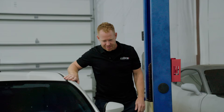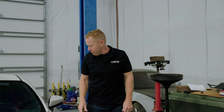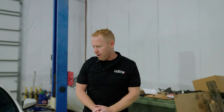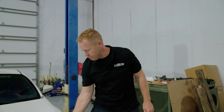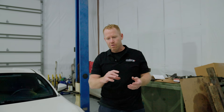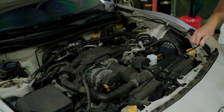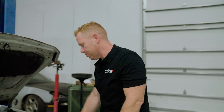This is actually a really good chassis, however we do have a common problem with the engines. The FA20 flat-4 just rod knocking for no apparent reason — this happens very commonly in the Subaru space. This specific chassis was 300 miles short of 200,000 miles when it gave out. Even though the oil was completely filled to the top, going downhill at higher RPM the engine starved of oil. This engine is completely bone stock, serviced on time.